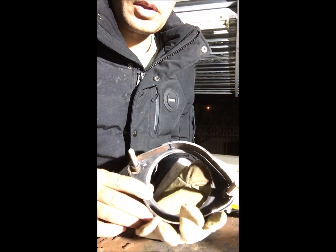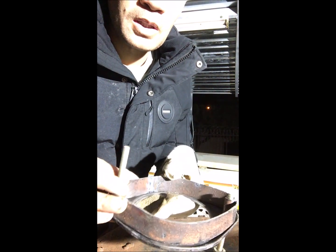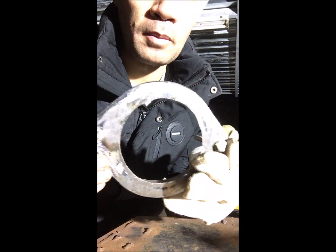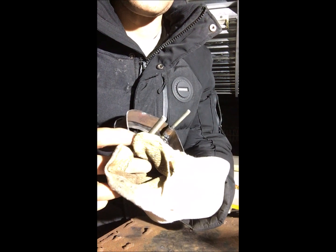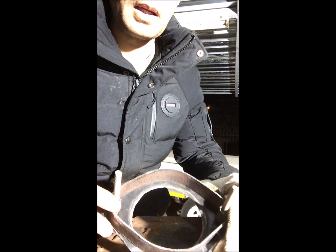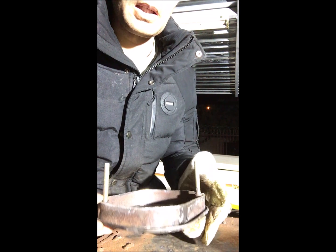As you can see, there is my extended mounting. I've used just two bolts to get it in line with the hole at the bottom. Once that's in, this lines up there — and that's all you need. The holes need to line up because this is gonna be the exact same shock mounting sitting on top, and I'll explain that further when I install the coilovers.